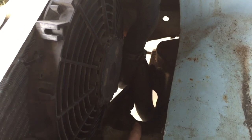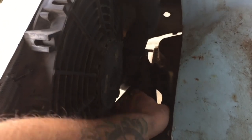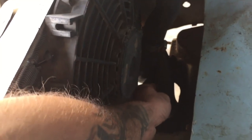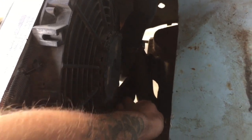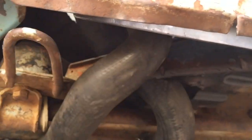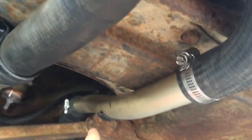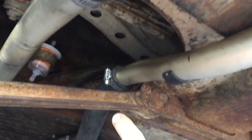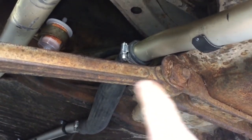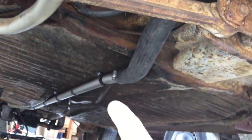Coolant flows down through the radiator, and then we go to the output of the radiator. I enlarged this little crossmember hole here — I still need to sleeve it because it is rubbing slightly. A little bit of pressure on that, so I don't want it rubbing into the hose. Anyway, that goes down to right here, and it also makes a bit of a compound bend — a pretty simple shallow S-bend to avoid the suspension.